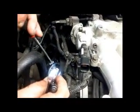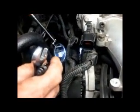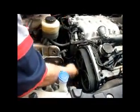We'll also use a mirror and check the back side. I'm going to get the tool off of here first. That one looks good, and that one looks good. The key points, the critical points, are all looking good. We'll confirm all belt tensions, no play, everything's in time.